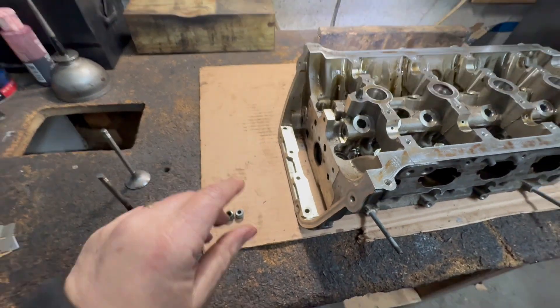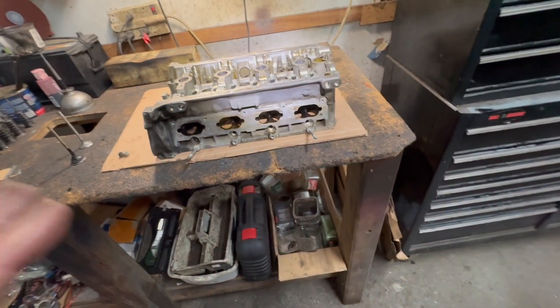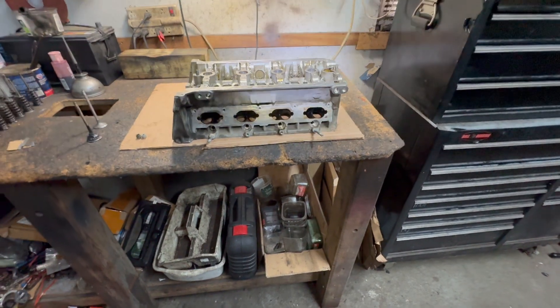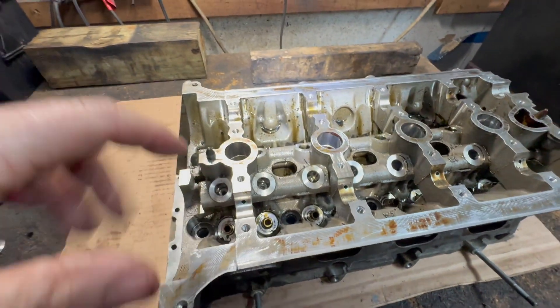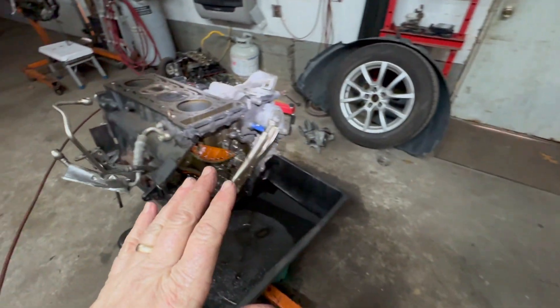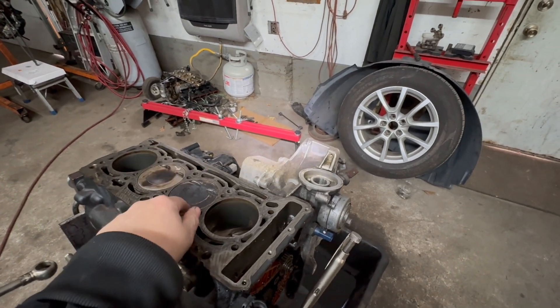Let's get back to the symptoms now. I've made videos on the turbo and the piston rings — there are all different types of telltale signs. So if your valve stem seals are leaking, what's going to happen is when the car is overnight cold and you go to start it, you'll see that smoke — a puff of smoke — or it'll burn for a couple of minutes. That's because overnight the oil is seeping through the valve stem seal, through the guide, into the combustion chamber, laying a puddle of oil on top of the piston. When you fire the car up, that combustion explosion burns the oil, and that's what gives you that blue smoke.